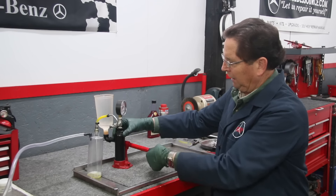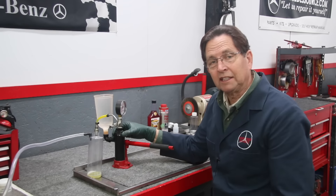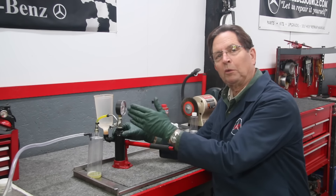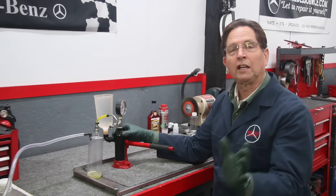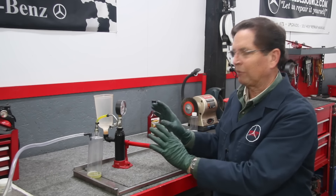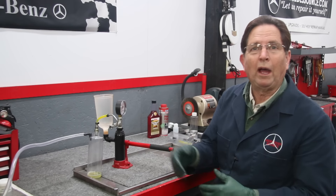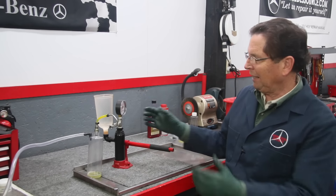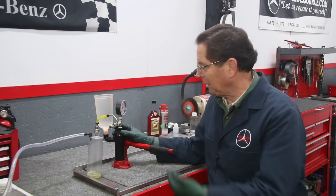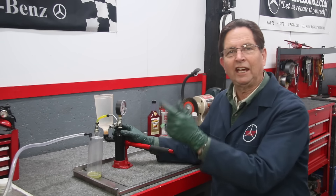You'll notice it's not dirty but it's not as clean as what I'm putting through, so you'll be pumping a couple cups of cleaner through. You won't know if this is effective until you mount it back on the tester and do an actual pressure test — checking the release pressure and watching the spray pattern. That's covered in another video included with my pressure tester. This series is just about back flushing to help with those stubborn injectors you can't get to test properly by flushing the normal way. I'm going to keep experimenting to figure out exactly what to include in the kit, try a few more cleaners, and come back in part three to sum it all up.